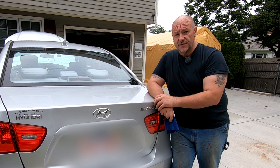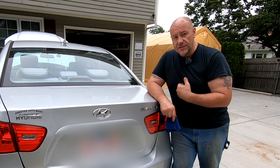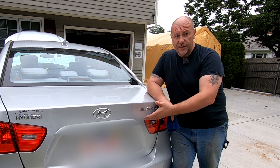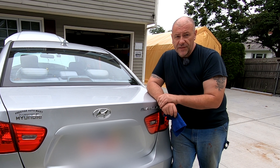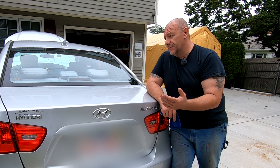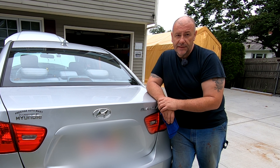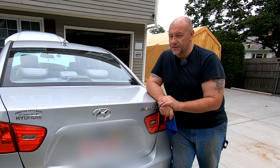So that's all there is to replacing the license plate light bulbs on the 2009 Hyundai Elantra. I like using the LED bulbs because they last longer and I'll probably never have to replace them again. You can buy the regular stock bulbs — they're a little bit cheaper, but I don't find them to be that much cheaper. The thing about LED bulbs is they use less power, so it's less of a strain on the alternator. And these cars do not have strong alternators — they're like 90 amp alternators and they can barely keep up with the car's electronics as it is. Not a good design if you ask me.